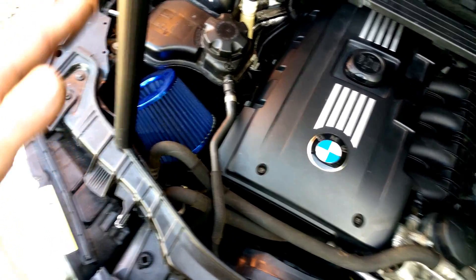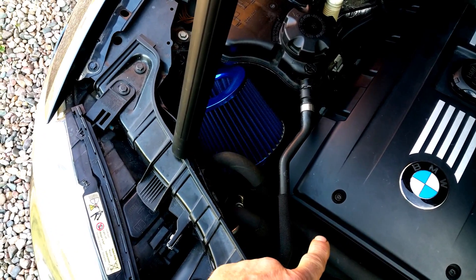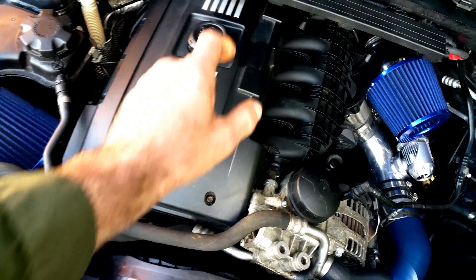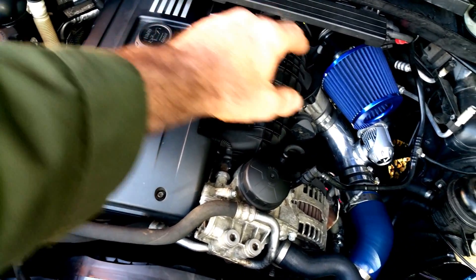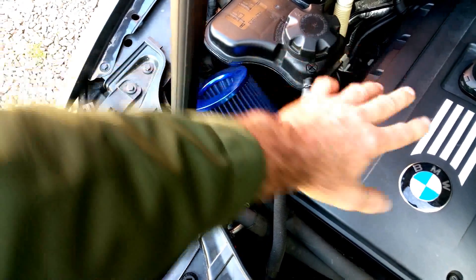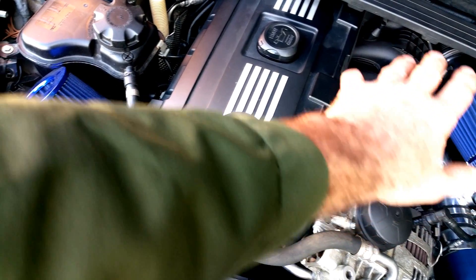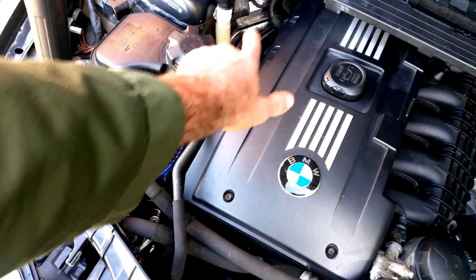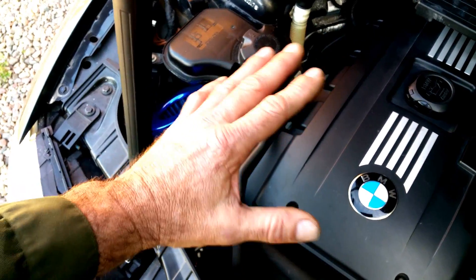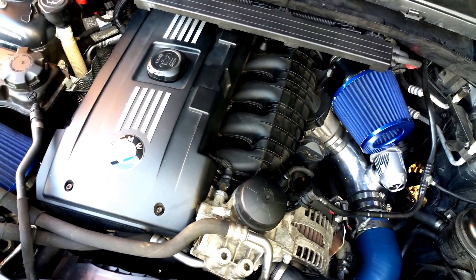Inlets — you're going to get with your stock turbos way more responsiveness. I was able to fit a three-inch down to a reducer coupler to 1.75 straight to the turbo, and on the rear side I have a 1.75 to a 2.5, then going up to a three-inch. I want to get shorter piping — I don't think I can get a three-inch to 1.75 on the rear, but I could go 2.5 and taper up to three. Inlets are a very, very, very important thing to have — that gets you a lot more power because your engine needs to breathe, just like any engine. It's like a large air pump.